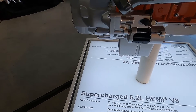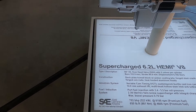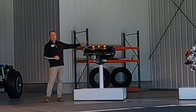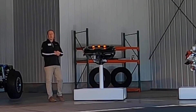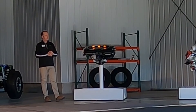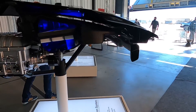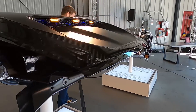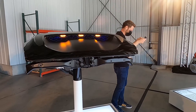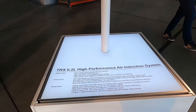Feeding this beast, we have to provide lots of cool, clean air. This cutaway deserves a little more attention if you guys can come up and look at it later. We have two air paths: a high-pressure air path in the functional hood scoop, and a high-pressure air path through the grille, through those RAM letters that Mike talked about. These two paths come to the bottom of the airbox — the dirty side — and tumble the air, tumbling the sand, grit, and dust out of the airflow. Then it goes through two giant 8-by-12-inch air filter elements.